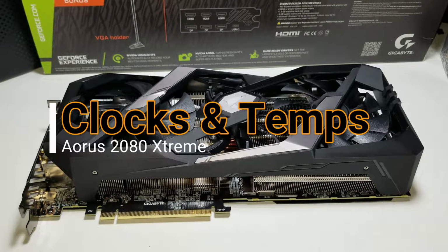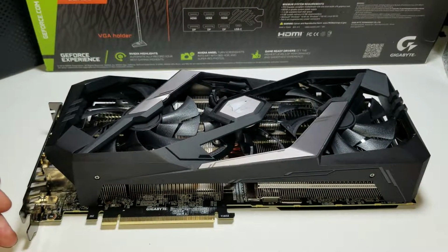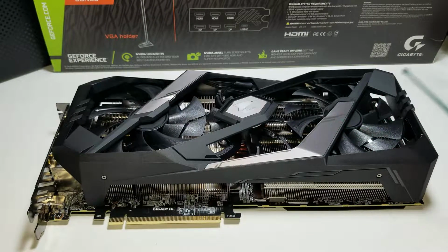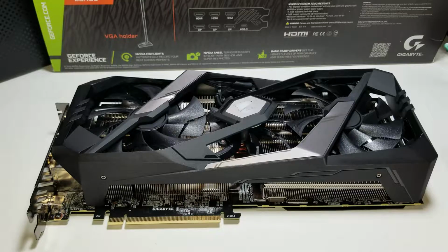14140 on the memory frequency. I've been able to overclock it. I can go as far as plus 80, which brings the real world gameplay, if you look at the benchmarks, I believe to 2080 megahertz. I've seen it up to 2100 megahertz. I believe there's a glitch on the Heaven benchmark where it goes up to 2180 or 2300. It doesn't go up to that in reality. It only goes up to like 2100, but it goes back down.